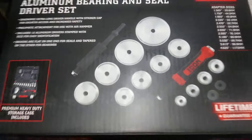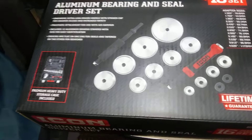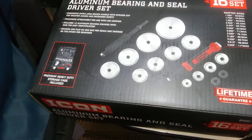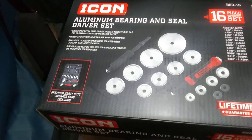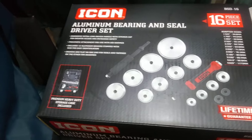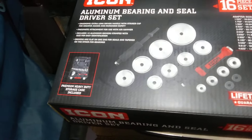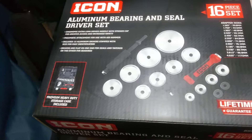This is a tool you probably won't be using every day, but when you need it, you need it. It's a specialty tool. When you have to put in wheel bearings and you have to drive the races in and the seals in, and you don't want to use a punch or a socket. A lot of guys use a bigger socket to pound them in, and that can damage the race, and then you'll be putting in more wheel bearings.